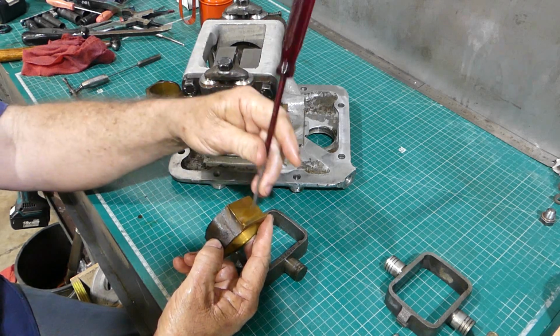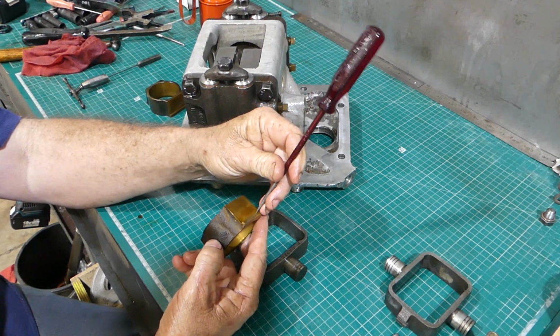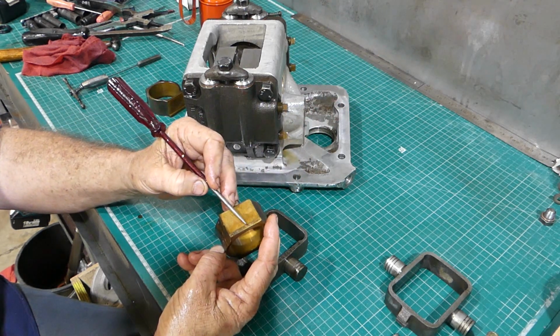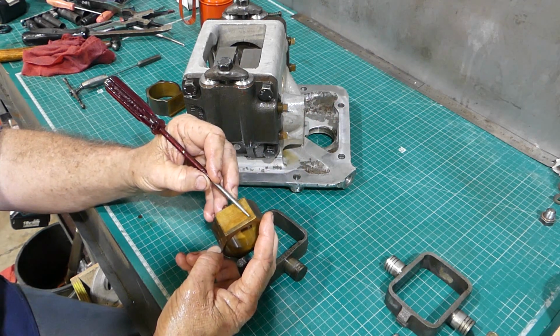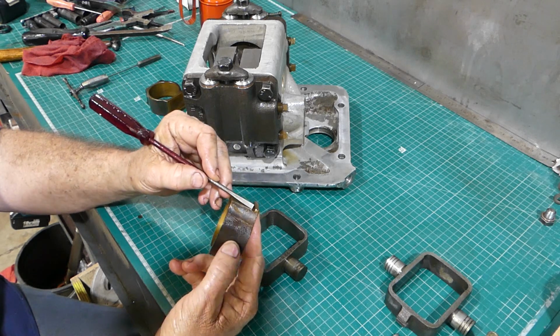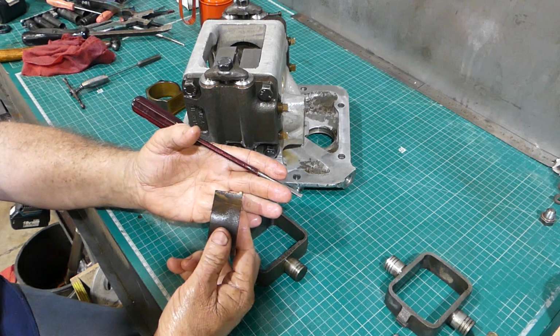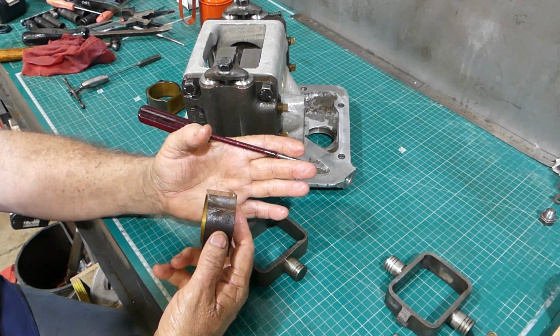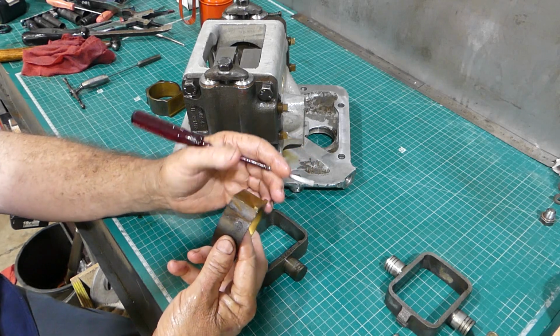Well, this angle, instead of being straight up and down, was out ever so slightly. The outside shoulder here was correct. The inside shoulder had a bit of a chamfer. So what I had to do on my pump, and look, I'll document all this and talk to Sparex about it. They won't know for sure.